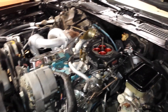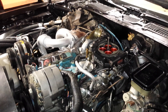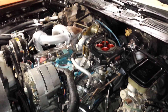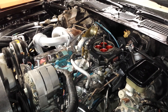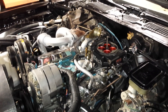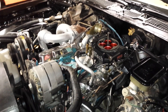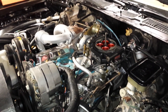I want to take a moment to talk about timing. I get a lot of questions about the distributor and ignition wires for the 301 turbo. I'm going to take the distributor out of this car — it has a 1980-style distributor. The 1980 turbo cars get mechanical timing with a vacuum advance, and weights and springs inside the distributor.